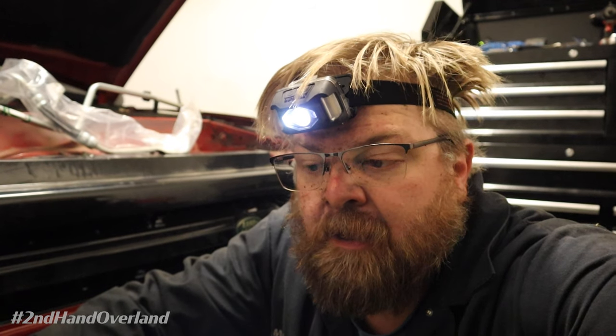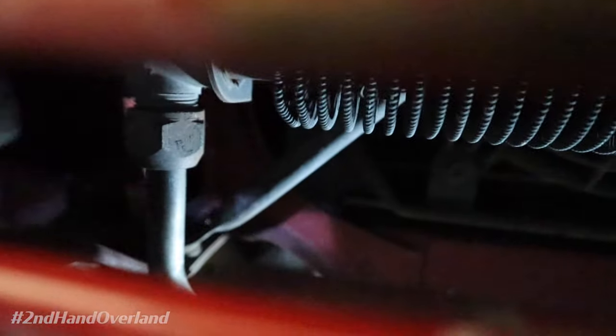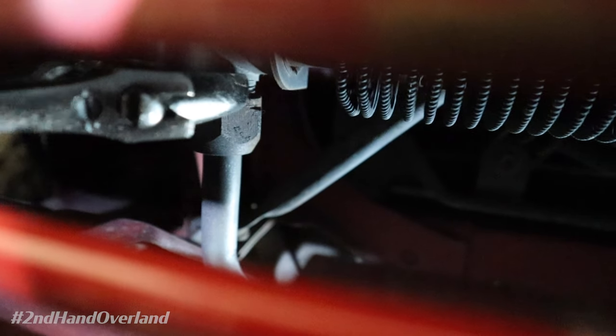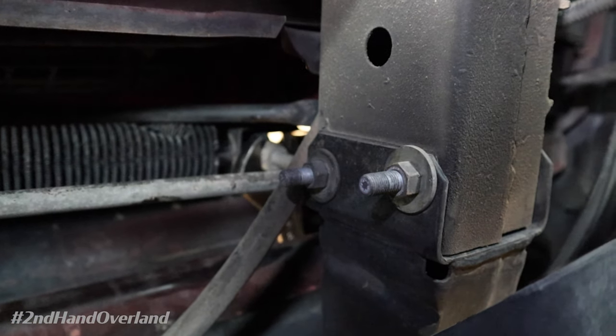Set your drip pan down onto the front right of the vehicle underneath the front right oil cooler connection. I've heard people say you need to take the grill apart to get this cooler line out, but I'm thinking that's not the case — I think I may have just found a little loophole. If you look right in there, you'll see the nut that we're after. You'll also see that you can capture it right here with a crescent and spin it free — just right through that hole. Connect the new line back in there and route it towards the back to the transmission, but leave it disconnected so you have a little space when you reconnect the other line later.